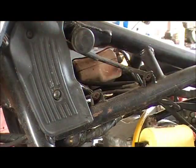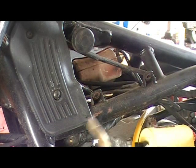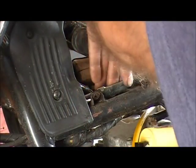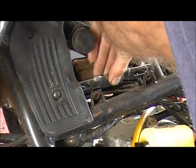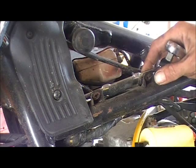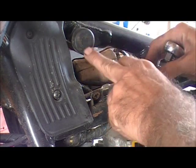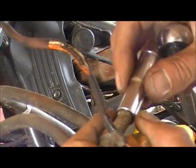Oh, and I done set that down and I needed this. Alright, look. Take your little towers here. And actually, you know what? I almost wonder. I need that up in there because if I put that bracket right there, I'm going to have the coil hitting the inside of the tank. Because you see that line right there follows the tank pretty close and that coil will be out here a little bit more around. So here's how this goes. Take your studs and spacers off your old one.